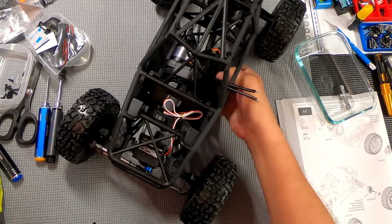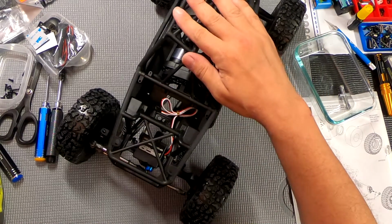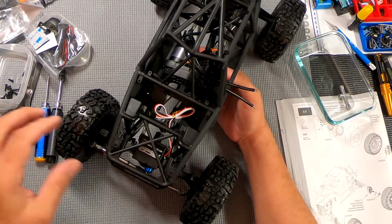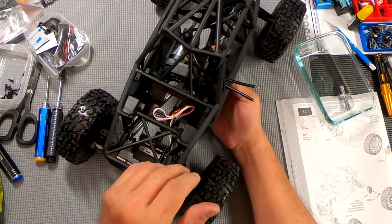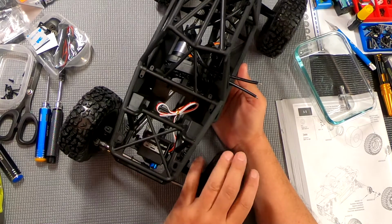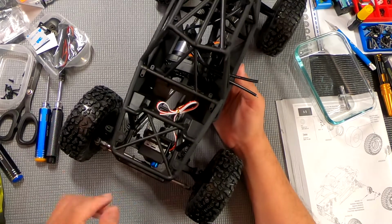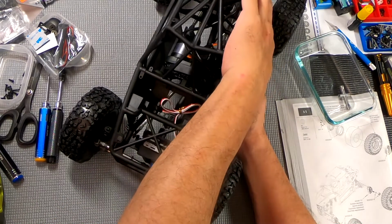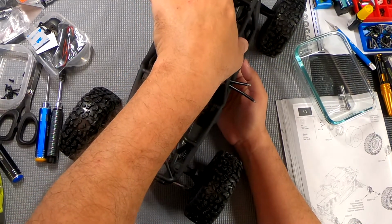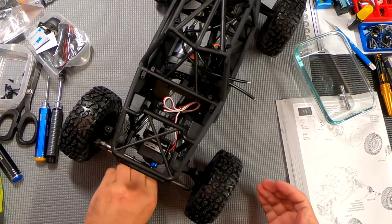It's got a little droop. It could stand to have a little more. I might go with a softer spring, because a softer spring would let it hang a little more. You want the center to be reasonably high because you want the clearance, but if you're trying to climb over something, the skid plate will let it slide and the wheels will drop down. They won't have as much pressure on them, but they do weigh a good bit. There's a lot of weight in these axles with the portals, and I may add some brass down here. So having a softer spring, because I can't adjust the preload any further, to let the chassis sag a little more onto the suspension might be a good thing. Anyway, I think it's off to a great start, so we'll see how that goes.